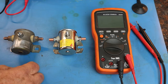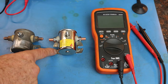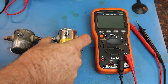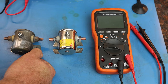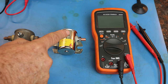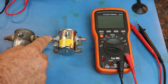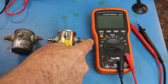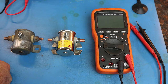How do you turn on a solenoid? You run current between the small terminal and ground, and that in return allows much larger current to flow through the large terminals. For example, in your car, when you try to start your car, you put the key in, turn the key, and it cranks the starter and starts your engine. You can use a very small amount of current between this terminal and ground to energize the solenoid, which then closes the circuit, creates a valid circuit, and allows very high current through the solenoid to the starter of your car to crank and start your motor.